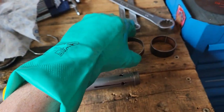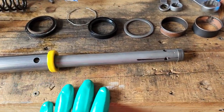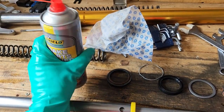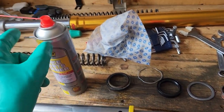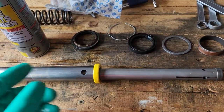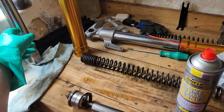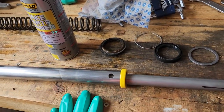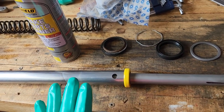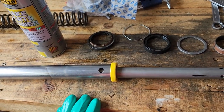How did I clean it? Brake cleaner. Trust me — get a good can with a lot of force in the spray. It actually gets rid of everything very easily, especially when you have to do the boot. We're going to let this flash off, have a cigarette — obviously not next to it — and in about five minutes we can start reassembly.